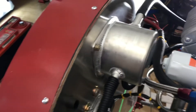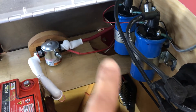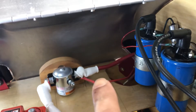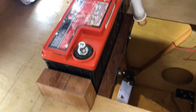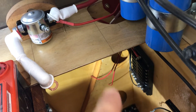we'll take a look at where I chose to put my stuff, which is inside here. The firewall pass-through comes from here to this splitter, and it goes to two coils — one there, one there — and then all the power comes to the coils. This is all kind of neatly mounted underneath here. And of course, this is the heavy four-gauge coming from the master solenoid to the starter solenoid. The heavy battery I had to mount and rig up — it's a wooden airplane, so I have to figure out all this stuff. Down under here is the bus bar, positive and negative bus bar.